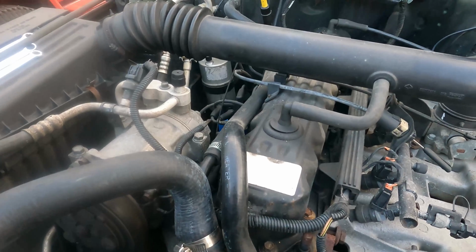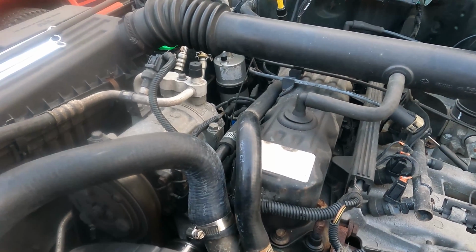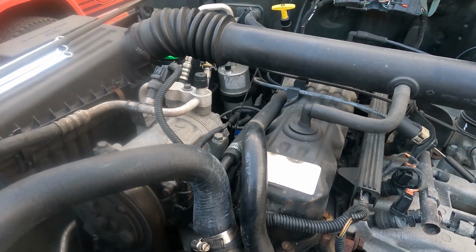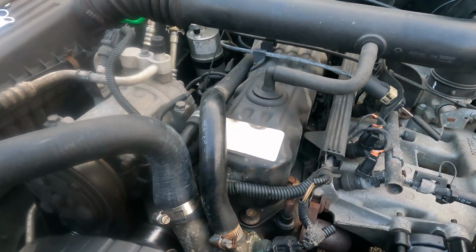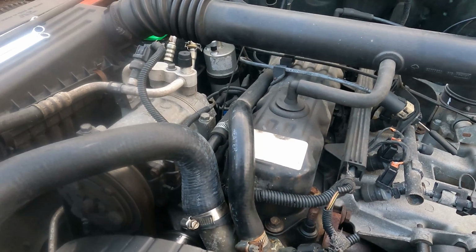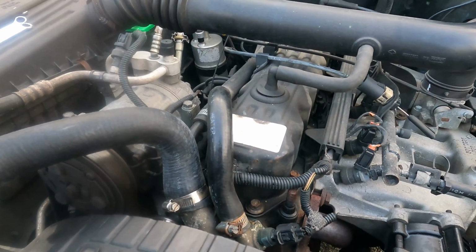There may still be a small bubble in the radiator or in the heater core when you do that. However, that is a super small capacity core, and it won't be much if there is any air in there, because the water pump turning circulates the coolant continuously through the heater core, and that should take care of that bubble as the engine runs at operating temperature and things like that.